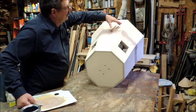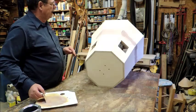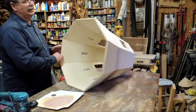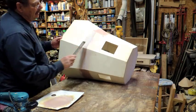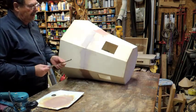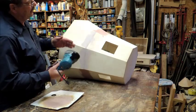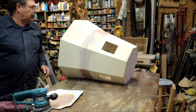We're getting the transition between the two pieces, putting a little body filler in it — just put some on and sand it down to a nice smooth surface. That's it around the perimeter — looks pretty good. There's a view from the inside. I use a file to take off any hard stuff and high spots. You can see this is convex — that works very nice for taking off high spots. Then I use my sander: I've got 60 grit on there; later I'll go to 80 and then about 120. Then I'll do some priming and see how smooth it is.